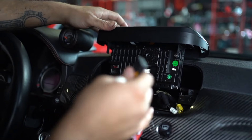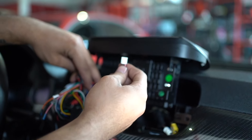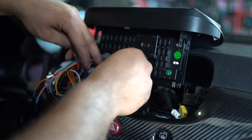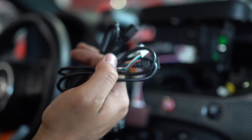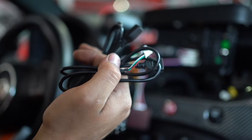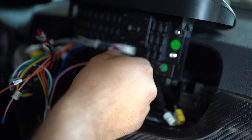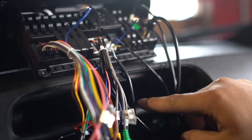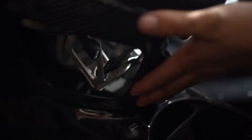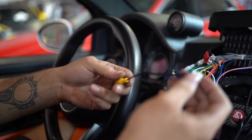Plug this connector into the back of the radio, then take the connector coming out of the simple soft box and put it back into the radio. You also have two USB ports — you can install them now if you wish to use them. For our installation, we've opted to just run our main USB connector, routing it down and into our shifter housing. You also have a connection for your backup camera if you've opted for one.